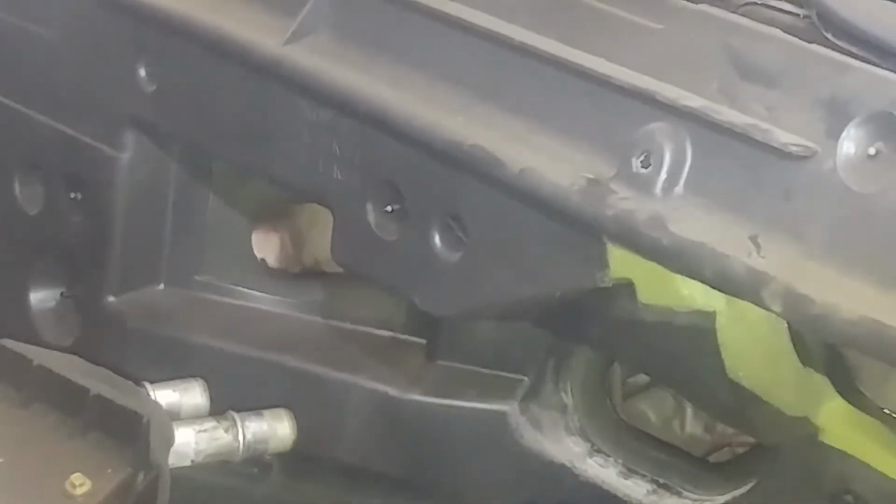All right, this was just in here. That just fits up in here. Trying to push that back on there. Sorry. Trim's just kind of coming off, but that's all right. We can push it back on. So you can get this out of the way if you want. This fits a 10 millimeter. Otherwise, here we are. Access to our heater core.